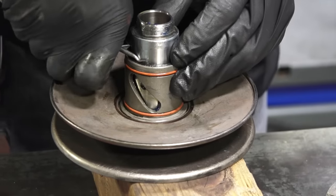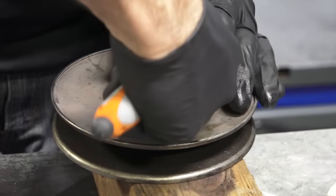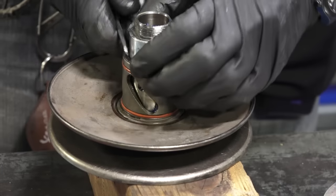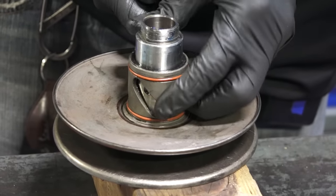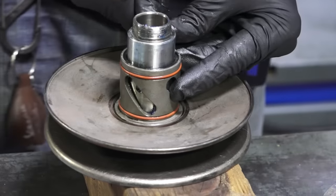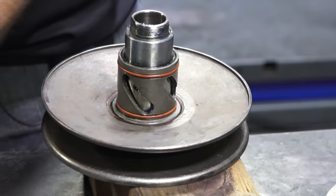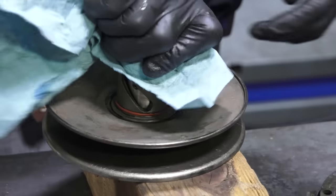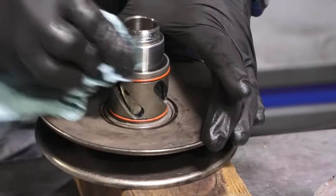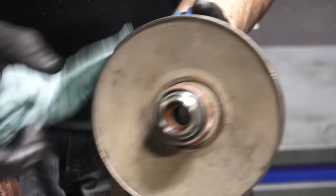Pack the needle bearing with a small amount of grease — the other bearing further in is fully sealed. You don't want to pack it so much that it's likely to leak out. The needle bearing has been re-greased and is good to go. Now, if you were doing this in a shop setting with the factory adapter tool, the whole thing would go together in about two seconds — but this shows you how to do it without all the specialized tools that aren't easily available to home mechanics.